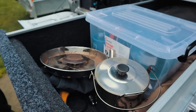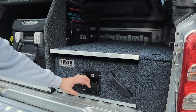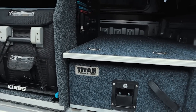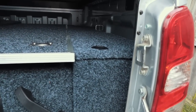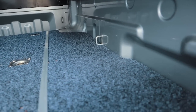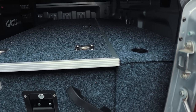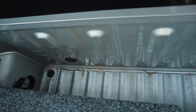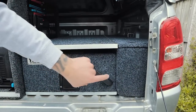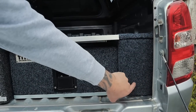The wing panels are really what you make of them — obviously you've got to cut and fit to your vehicle, one size fits all, but the quality of the finish is really up to you and how much time you want to spend on it. Make sure you get a really nice neat finish to stop anything falling down the cracks. We've left a bit of room at the back behind the drawers and the wing panels to put our gravity-fed slimline water tank, and we'll have a compressor mounted in this wing panel with the outlet here and a little tap coming out the bottom.